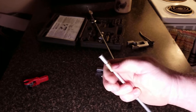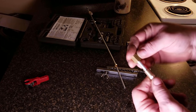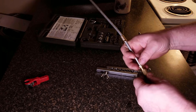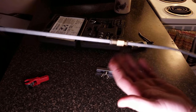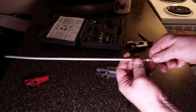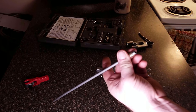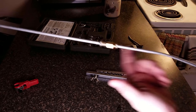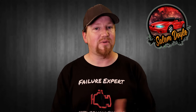Once you have this side flared with the flare nut on it, take the coupler — you'll see it has a fitting where both sides fit tight together — and screw the flared line in. Then take the line from the car, put its flare nut on, and screw it into the other side. Tighten both sides with wrenches. What's great about this is it's 100% solid. Even before tightening, the end of the line is captured in the flare — you can't pull them apart. That's exactly what you want in a brake line, something your life literally depends on.